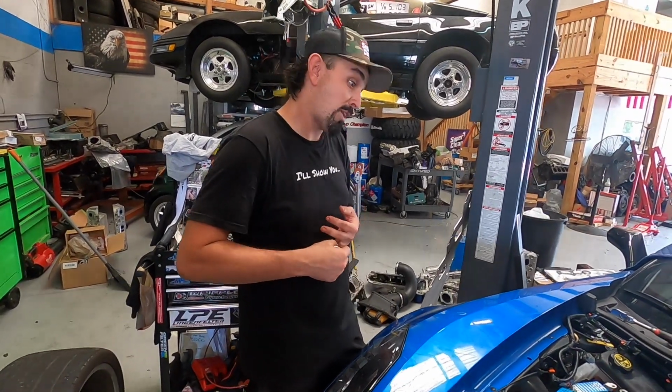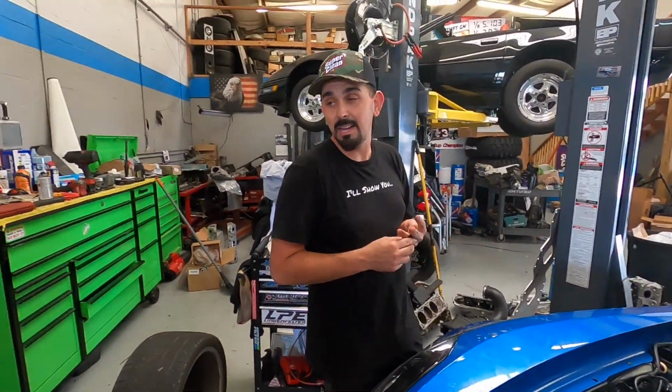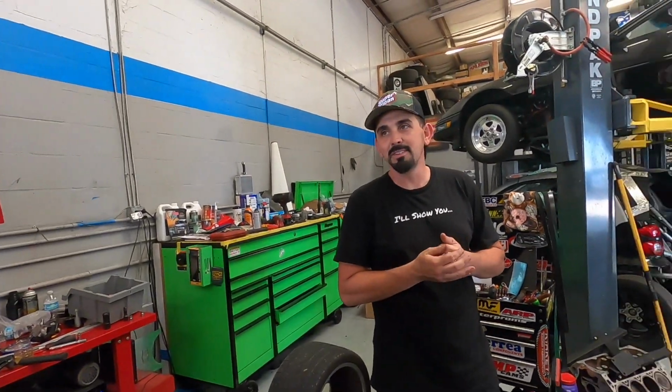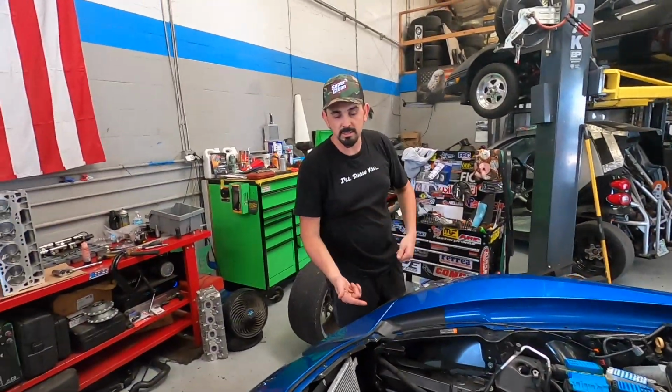Speaking of airflow, also we're putting a big old Nick Williams on this unit. Indeed. Big 5-inch intake, which is not here yet, I don't believe. So we're going from about an 87 millimeter throttle body to a 103 millimeter throttle body, and that alone is going to play a large role in making a bunch more power here. Yeah, dude, these things love a Nick Williams. Exit speed headers and X-pipe. Alky control meth kit going on.